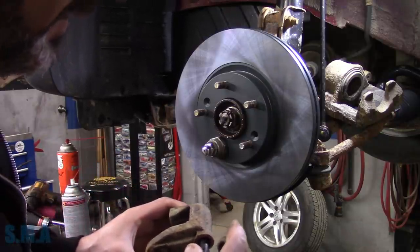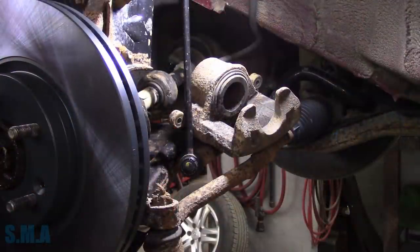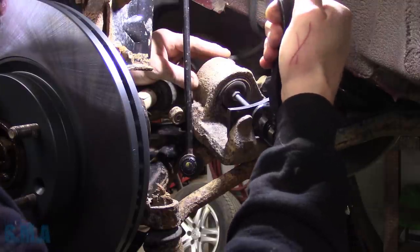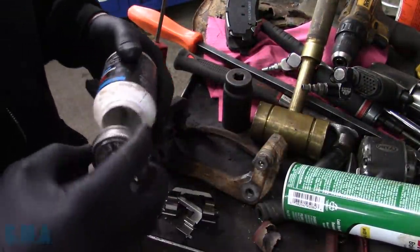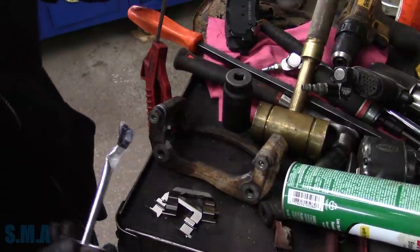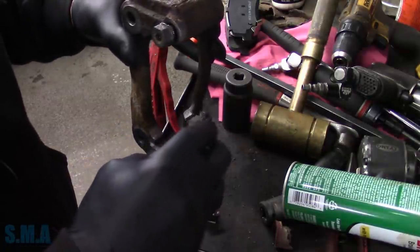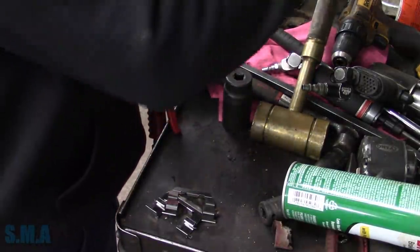We'll get this thing cleaned up. But before we do that, let's make sure that piston goes back in on that caliper - I'd hate to get that thing all cleaned up and find out this caliper's smoked. She's going in real nice - phenolic piston, it's French for plastic. I believe I was cleaning the caliper bracket, which is now clean. So we're going to apply some silicone grease - I'm all out of the Permatex extreme, so we're using 3M, not a sponsor, just regular silicone brake lube.